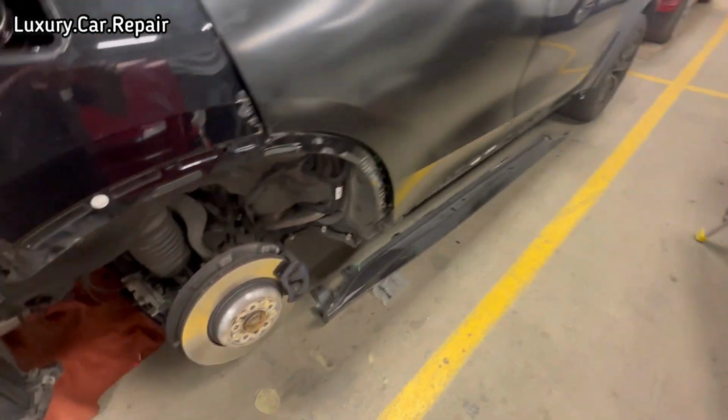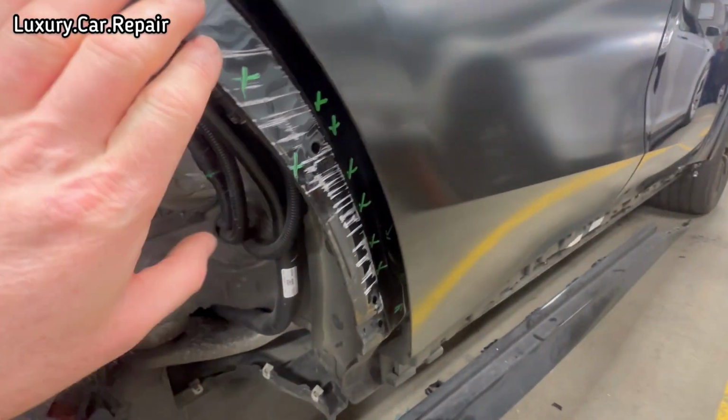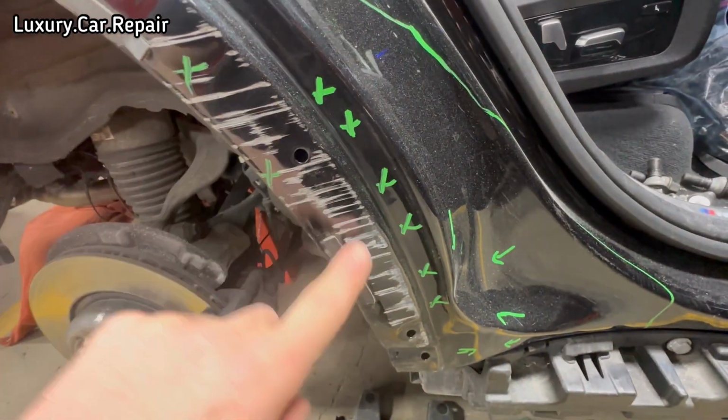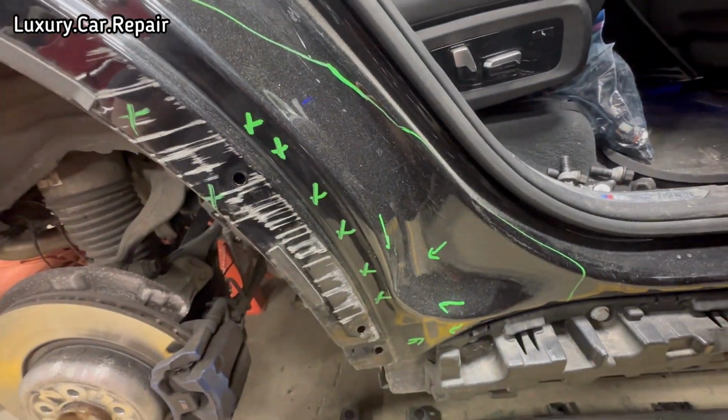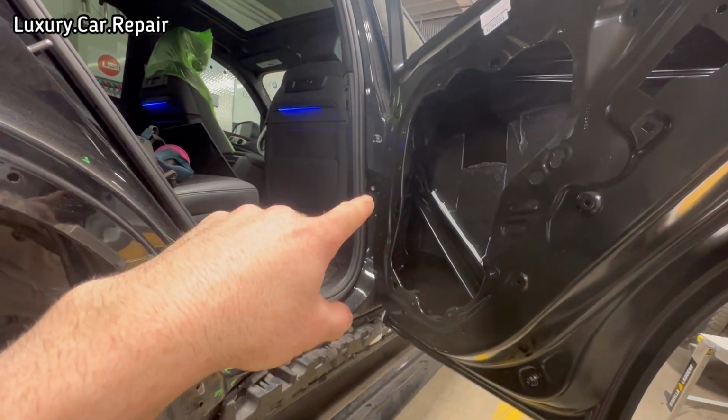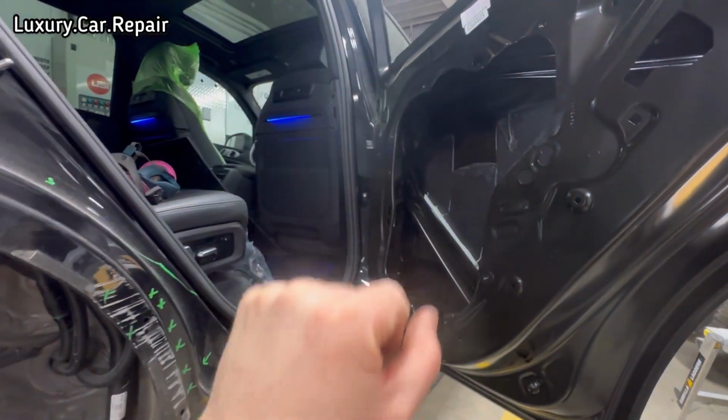And then obviously our dog leg here. See what I'll do with this one is weld keys on here, get it out, try my flare on, make sure it's flush with the door. But yeah, like I said, what I'll start off is I'll loosen the trim here, get the door forward, and then go from there.